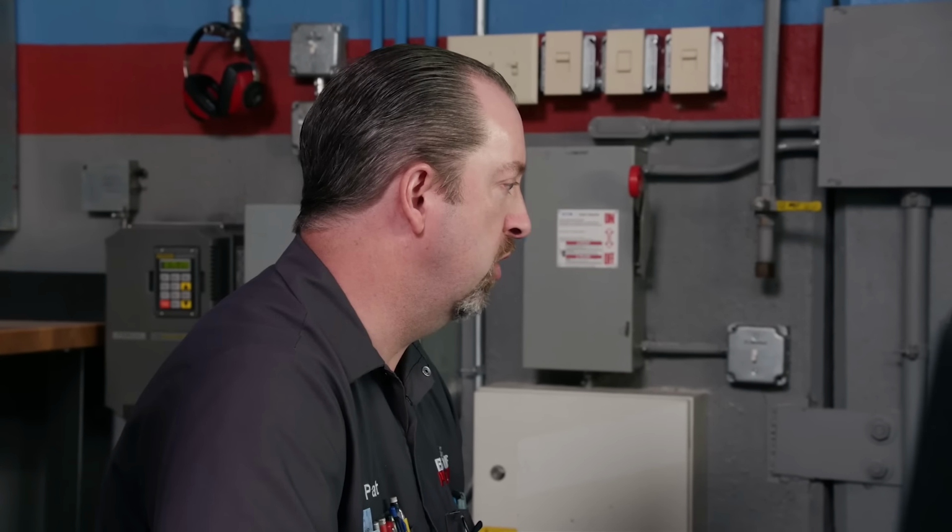So yeah, we are going to go from 4,000 to 7,500. Now I don't know how much boost it's going to have. I don't know anything, so I'm gonna leave the step size at 450, because you can load it too much or not load it enough. I think 450 is going to be a good balance. And we're still on pump gas, so that's the big kicker. All right, 4,000 to 7,500. See what she does.